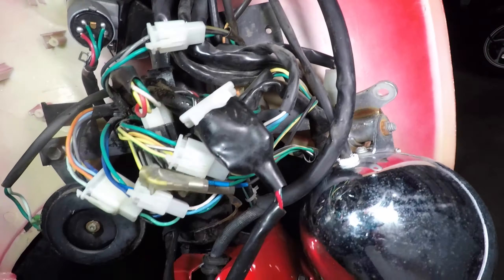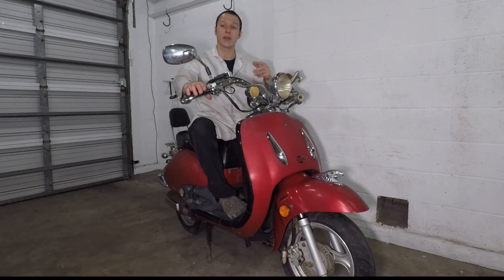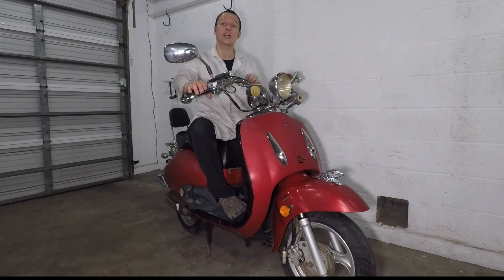Squeeze the brake lever really hard and hold it. Follow the brake hose down to the caliper and make sure there are no leaks. It's good, so I can put the cap back on. I spilled some brake fluid so I must clean it up — DOT fluid will destroy paint. I'm adjusting the brake lever on the handlebar and tightening the bolts. Chinese scooter mirrors always come loose, so use a bit of Loctite on the threads. Tighten the mirror on the lever and hold the lower nut. Loosen the upper nut if you need to adjust the mirror. Don't forget to plug in the two brake switch wires — it doesn't matter which one goes where. Put the brake hose behind the headlight and put the headlight back on. Now I can reinstall the fender. The front fairing goes on last. It's a good idea to leave the screws loose until you've installed all of them, then go back and tighten them. Be careful not to over-tighten the screws so you don't break the plastic. With a fresh new front brake, this scooter is one step closer to getting out on the road and killing me. But don't worry, it still has plenty of other problems, so be sure to check out my other scooter repair videos.